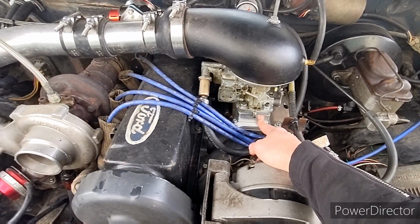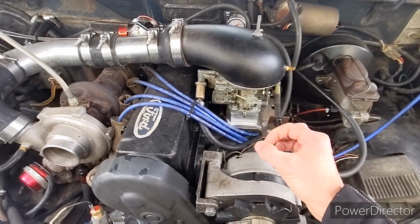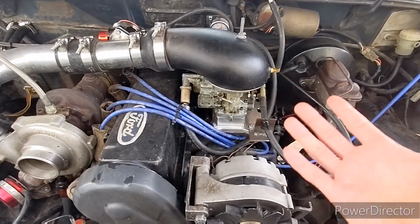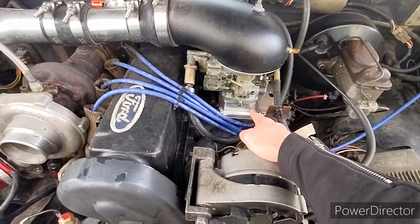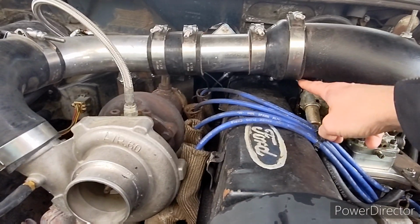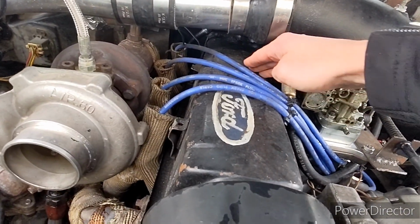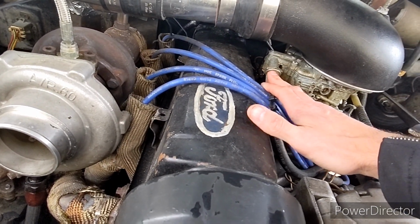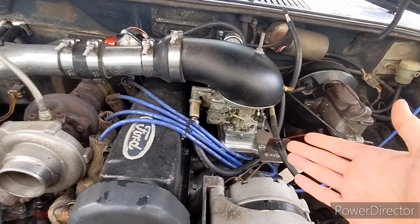Not really sure. It's a 1-inch spacer. I really like it. It's got a cool little design in it, kind of a tapered design. It's supposed to give you more torque. I don't know if it makes a big difference or not, but that's my setup. So intake, adapter, spacer. And the reason I got a spacer is because I like to have a little room between here. That's just my preference. I know some people have notched out their valve cover for simplicity and supposedly performance. I went ahead and put a spacer on that.